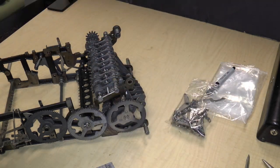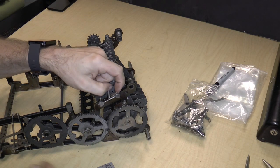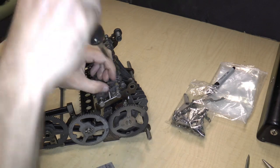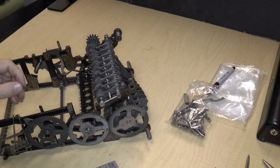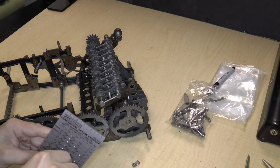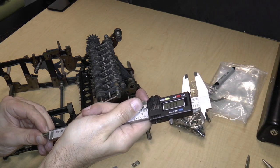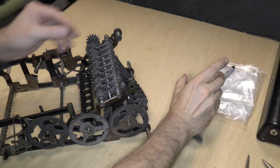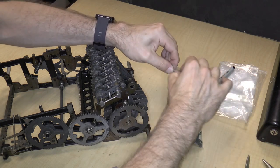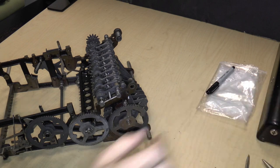Okay, I think we're probably almost done with bag five. So then there is one last screw right over here with this half bushing. Actually, it's even less than half a bushing. So I'll unscrew that. Oops, bushing came off. So it goes just like that. And it's an 8/36 screw, and its length is 0.314. So that goes in the bag. And I'm going to close off the bag because I think that there's nothing else holding this in. So I can close that off, set it aside.